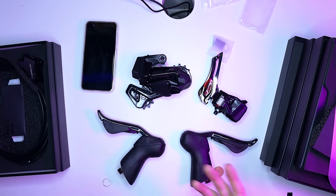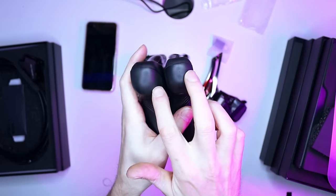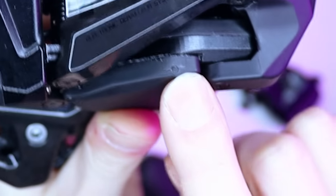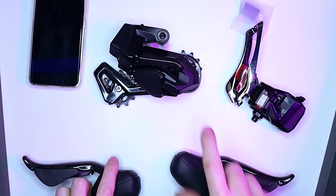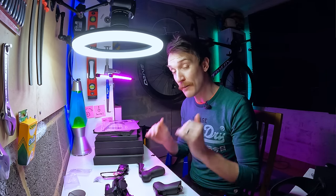They're all paired up, though it was a bit of a weird process because there are no buttons on either derailleur to put them into a pairing mode, and the English translations on the manual weren't fantastic. Here's the process: get the batteries out of the shifters from underneath the hoods, get the charging cables attached to both derailleurs, then pull the charging cable off the rear first — a little light will flash blue to indicate pairing mode. Next pull the cable out of the front derailleur and it'll flash blue, then quickly flash green to show the two derailleurs are paired, then blue again as it waits for the shifters. Pop batteries into one shifter and it'll flash green, batteries in the other and it's done.